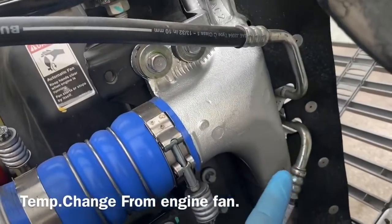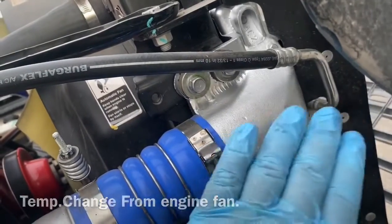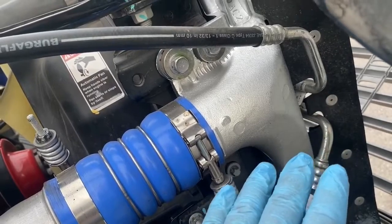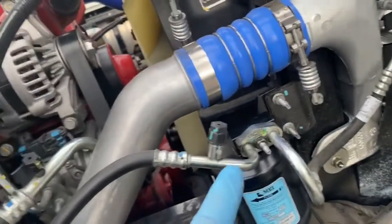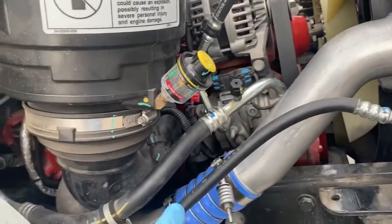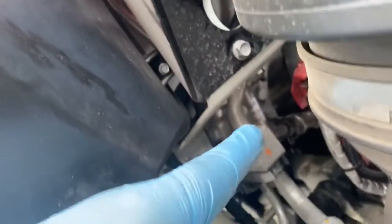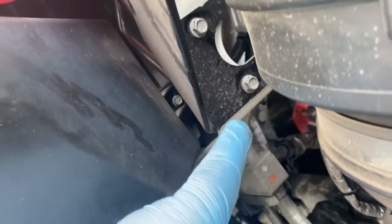This one could be hard to touch by hand; you can't keep it there for that long. So this one here, it's going to be warm but still hot — you'll feel the difference in temperature and you could keep your hand a little longer. And it comes out, goes through here, comes around, goes up to here and goes back up into your cab. That's not your expansion valve, that's just a block. It goes up, but in the firewall up in there is the expansion valve — you can't really see over there.